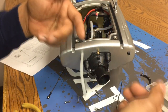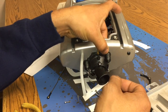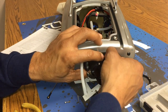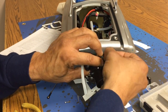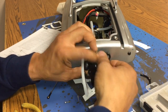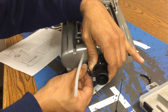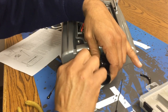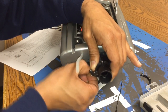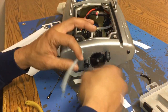At this point the pump is loose, but I don't want to just pull on it because it's going to pull the bellows out. Since this transom is pretty thick, plus the thickness of the inside and outside of the pump housing, it makes the bellow a little bit hard to put on if I do pull it out. So you can grab the bellow and just kind of wiggle it through the hole as you pull on the housing — it will come out. Same thing for the other side, just maneuver it through the hole so it pulls out of the pump housing. Very easy to do.